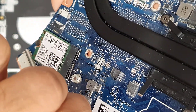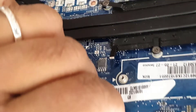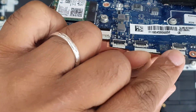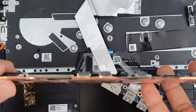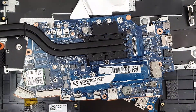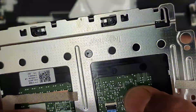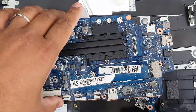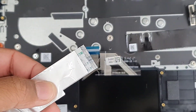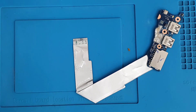Now we're going to check if we find any damage anywhere else. Here also I can see — yes, all the connectors have a heavy stain. On the trackpad as well, as you can see, there is a little spot. When liquid gets to the motherboard, you can see a kind of white deposit, like calcium oxide. And now let's check the flex cables — I can see on the flex cables there are a lot of black and white marks. Now we're going to focus on cleaning those.